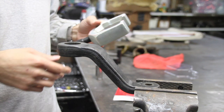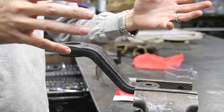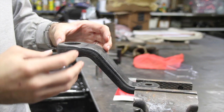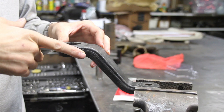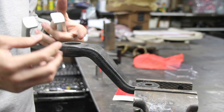First, what we should talk about is what is a pitman arm puller. A pitman arm puller basically pulls your pitman arm. You've got your steering gearbox, which takes input from your steering wheel and tells your wheels which way to turn. You have a shaft coming out, and then the pitman arm gets bolted to the shaft with a nut. This turns back and forth, which takes the drag link and the tie rod and turns your tires. When you need to change your pitman arm or take it off for any other reason, you have to use the pitman arm puller because the nut comes off but it's been on there so long, wedged up on there, that it's really difficult to get off — sometimes they're rusted on.